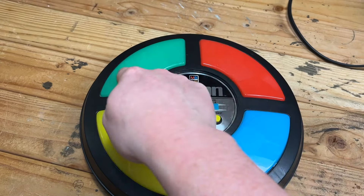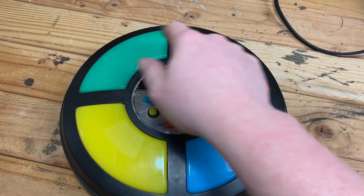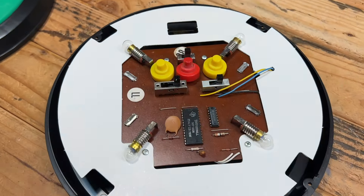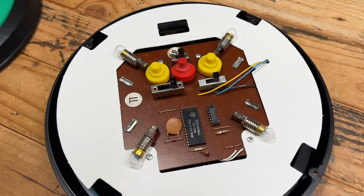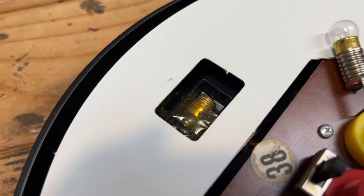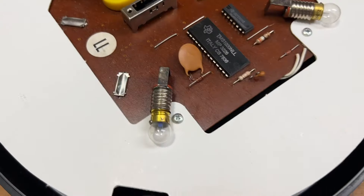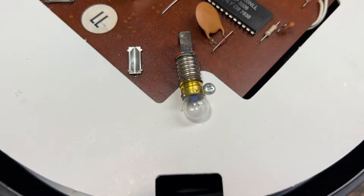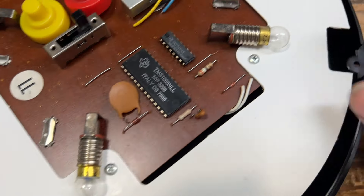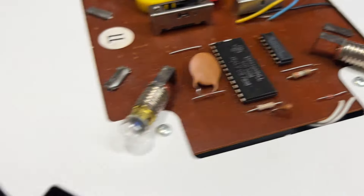Well, it does work. These two bulbs are burned out, but I do know you can replace them, so that's what we're going to do. I got to open it up first and see what kind of bulb it is. Everything just lifts off after you take off the four screws, and here's the inside. Very simple. We have a Texas Instruments chip here and the different buttons, and it even looks like they have a spare bulb down in there — I was not expecting that. Also, looking a little closer, it looks like some of these just aren't screwed in all the way, probably preventing a good connection. So they're probably still good — they just were loose.